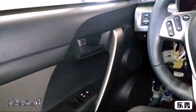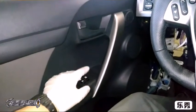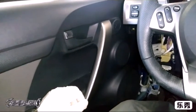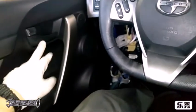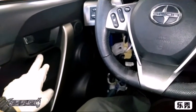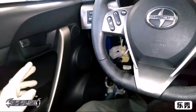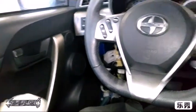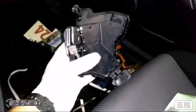You could test power and ground to the actuator. I'll take the door panel off and show you what wires to check, and you could literally see the voltage going to the door lock actuator when you're pressing lock, just to be sure. This one had neither door working, so it was confusing at first. But I realized that when these fail, they fail silently - they just stop working one day. You might not even notice one is bad for a while, and then your other one goes bad and you've got both out.